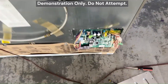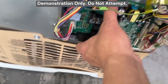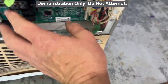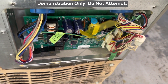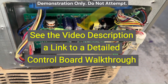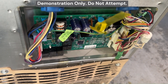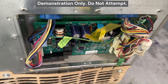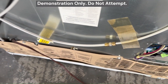I've got the new capacitors in the board. I'm going to go ahead and install this board back in the refrigerator. I'm going to test before putting the cover back on. By the way, I have a video on every detail of how this board works — from top to bottom describing every circuit and sub-circuit. Please refer to the video in the description for every aspect of how this control board works. Let's go ahead and plug it in. I just heard the compressor come on.